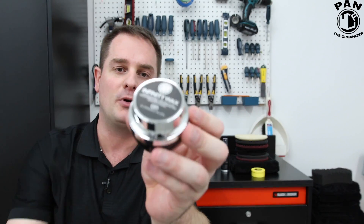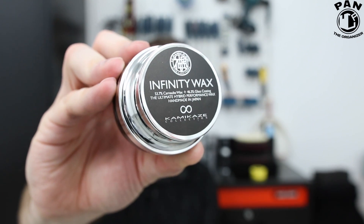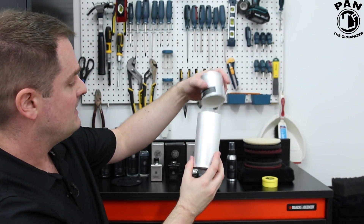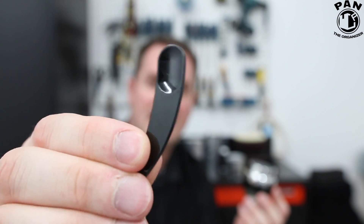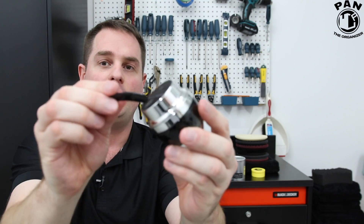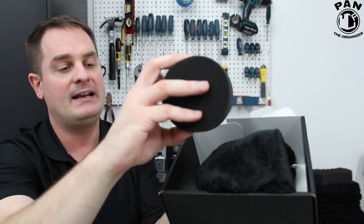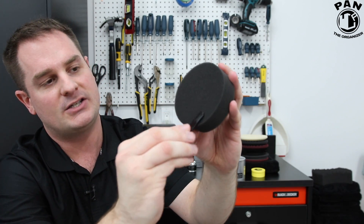Next up, we have their bespoke and super high-grade Infinity Wax. Infinity Wax is a hybrid wax because it utilizes over 53.7% of high-grade carnauba wax and 39.2% of Japanese glass coating. So in the pot, you actually not only get the wax but you also get glass coating too. It comes in an amazing box, which includes this cylinder. There's a nice pouch, and in the pouch you're also going to find this little plastic spoon. This spoon is made to be put into this pot when you open it — you stir it for roughly one minute. And then you're going to scoop up a bit of that wax and put it on top of the foam applicator pad, which comes in the box by the way, along with a plush microfiber towel. You scoop up some product and layer it on top of your applicator pad, such as you would put butter on toast.